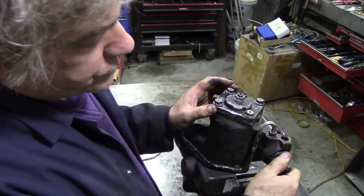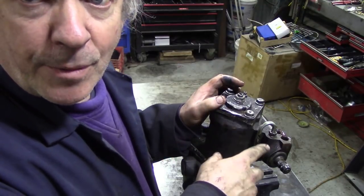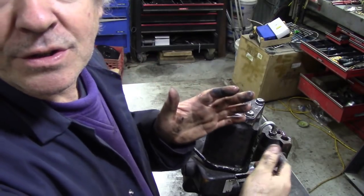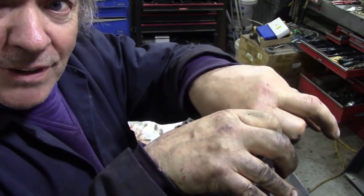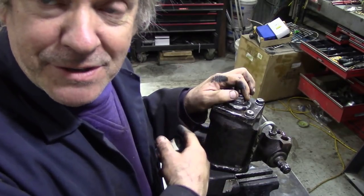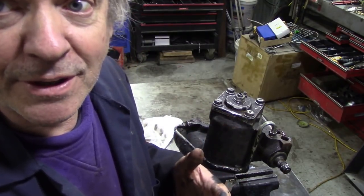But if you just turn your wheel to go around a roundabout, for example, the power steering valve will open. But once the wheels don't have any resistance, this valve goes to its natural state again. It's like on a flex, if you see what I mean. It's what we probably call a shuttle valve, and it allows fluid to go back to the reservoir, even though it's on a left or right turn. So it's not working all the time. Most of the time, the damn thing's free running.